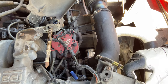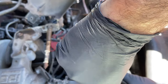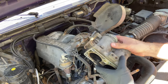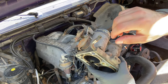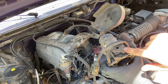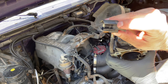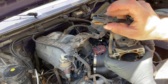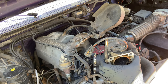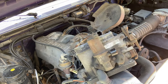There's one last thing you have to unhook and that's the throttle position sensor. So I'm just going to unscrew that. Getting the coolant hose off was a little tricky because of all the gunk buildup over time. The throttle position sensor screws are really hard to back out, and the connector is no less easy — Ford put a connector there that I actually broke one tab off getting it off, so I'm not perfect. What I did — probably very unsafe — is use razor blades to hold the tabs up so I could slip it off.